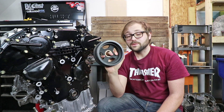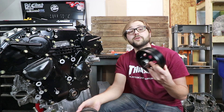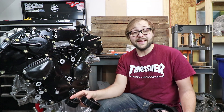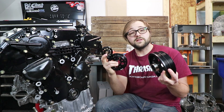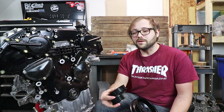Another upgrade you can do here is reducing the weight from the crankshaft pulley and ultimately freeing up some horsepower. The stock VQ35 pulley is an all steel piece at about 4.7 pounds, and you can buy all-aluminum ones that are only about 1.5 pounds. A lighter weight pulley is going to free up otherwise stored horsepower and ultimately that horsepower is going to end up going to your wheels. Throughout this build I've been looking for minor ways to make big changes — lighter weight pulleys could free up 4 to 6 horsepower, let the engine rev a little easier and ultimately breathe better, but the advantages of having a dampener on the front are also definitely a way I want to go.